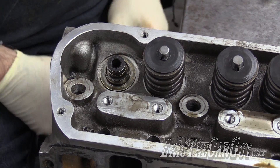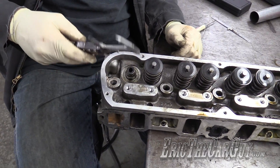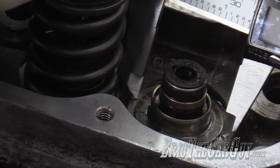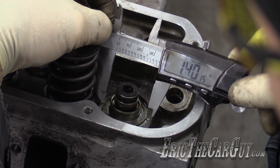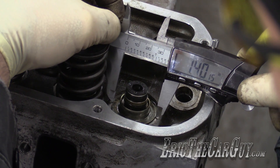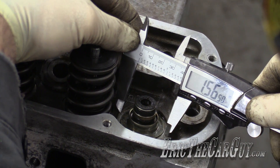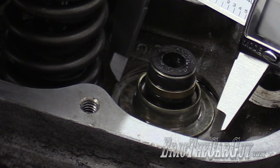You can actually take the valve out for this one. Look — an intake valve. For this measurement I'm also going to be using my calipers. It would be great to use them this way, but I can't get down inside the cylinder head. Since the valve spring sits on this inner portion, that's what I'm going to be measuring. Since it's circular, I want to see if I can get just around the outside to where the measurement doesn't change. It looks like 1.40 works really well. I'm also going to go to the outer edge and do the same thing — come to where the measurement gets the largest — and that's like 1.60.